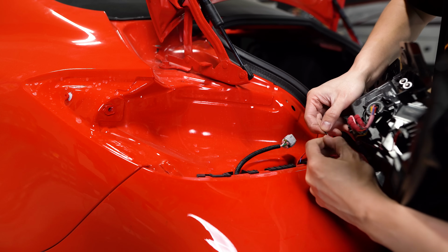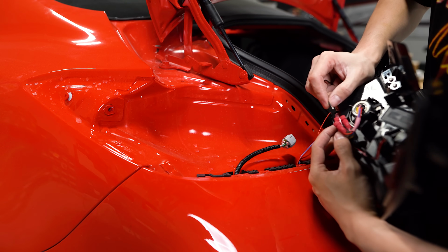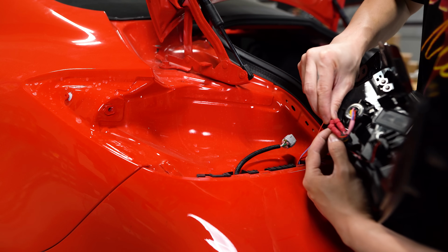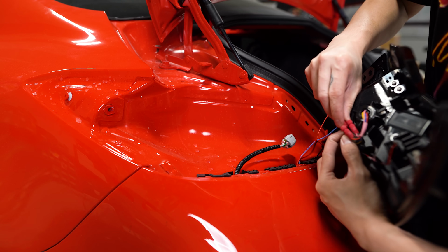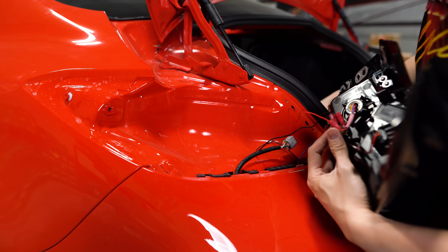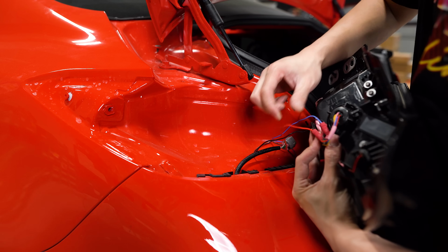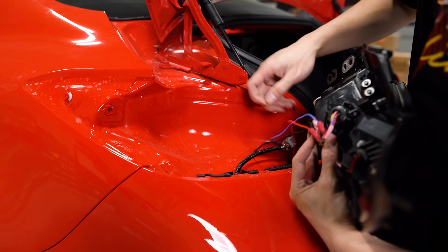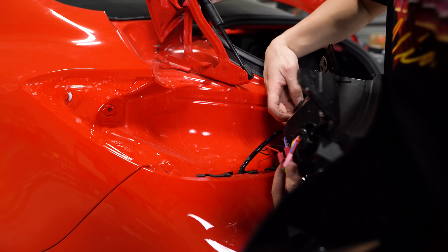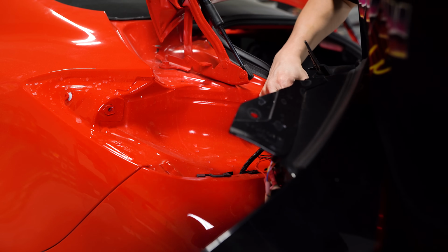The wires on the fourth brake light should already be stripped for you, so you just need to unscrew the posit taps a bit, stick these into place, and then tighten it back down to lock it into position. We're going red to red, same thing, and then blue to pink. So now you can see those wires are in there, not going anywhere. We'll plug the tail light back in and then reinstall the tail light. And hopefully everything works.